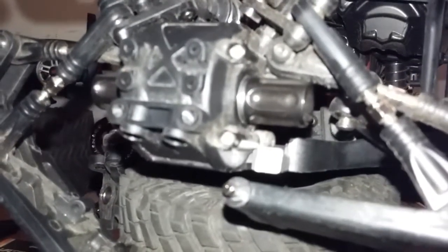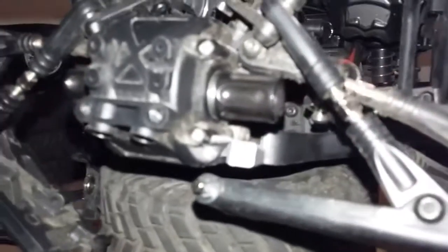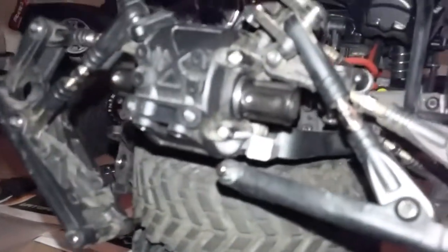The front differential is completely reassembled with all four screws tightened back down. In hindsight I should have replaced the bearing on the rear pinion shaft while I was in there, but I plan on upgrading to aluminum front differential cover, aluminum transmission cover, aluminum rear axle, and steel drive shafts through the middle later on. When I do that upgrade I'll swap out those bearings, and I'll also get an actual Vaterra ring and pinion at that point.